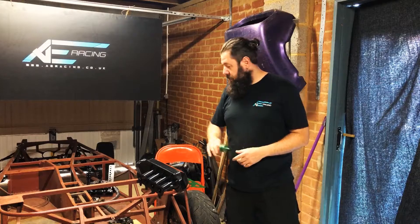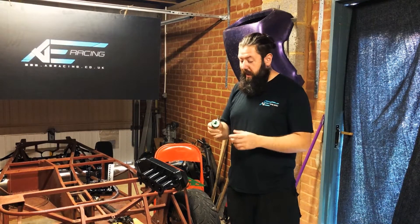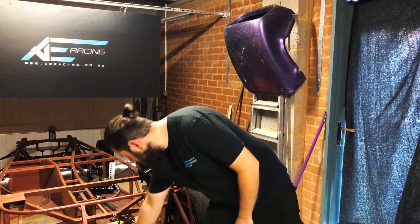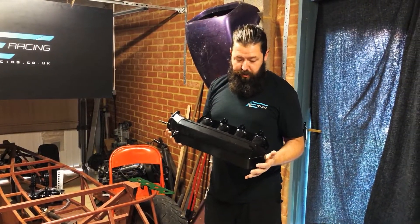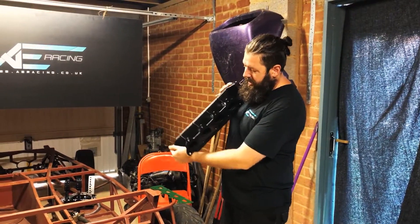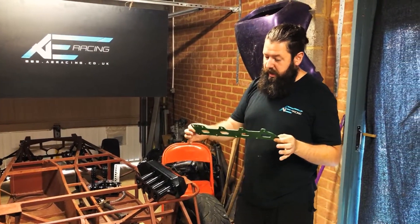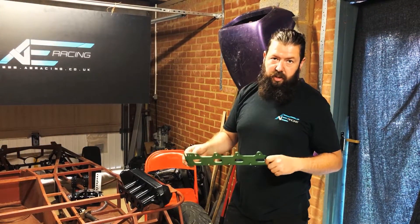More bits that we bought — these come as a pack from the 750 Kit Spares and they're all control parts again. First is a fuel pressure regulator: fuel goes in one way, comes out the other at a set pressure, to make sure everyone's keeping the same amount of fuel getting to the engine. There's also a purpose-made inlet manifold — air goes in through the throttle body and comes out of the individual ports into each cylinder. And between that and the engine block is a restrictor plate, which makes sure everyone's got the same amount of air going into the engine, keeping the same power.